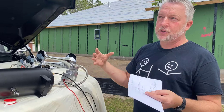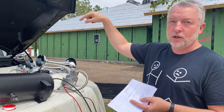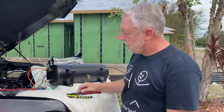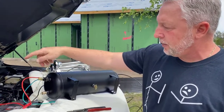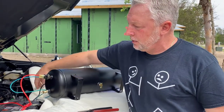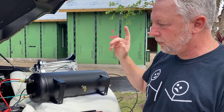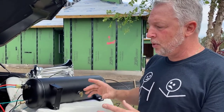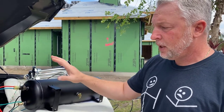Since this is a V8 I have a lot of room, so I'm going to put the compressor and tank right underneath the front. The whole system will be under there — no one will even know it's in the truck. I've got everything in a mock-up wiring: tentatively connected with a fuse panel to my battery for 12 volts, running out to the compressor power, with a pigtail lead from the valve so I can test the horn. The fun part is coming soon — but first, make sure everything is safe.